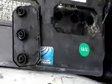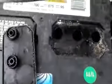See? Look, this one's actually low. I'm surprised it's even holding a charge. It's very simple, though. I mean, every battery needs water to transfer the current. So if you have a bad battery or it's not holding a charge or something like that, it's probably just low on water, if not completely out of water. So check these before you go buying a battery, because, you know, batteries are expensive these days.